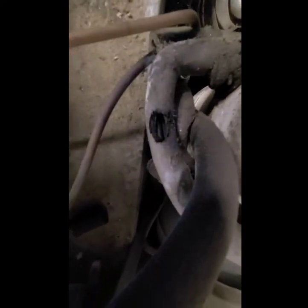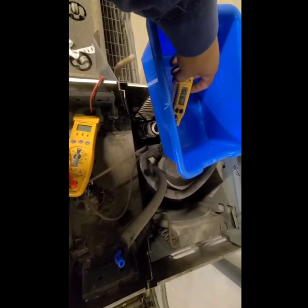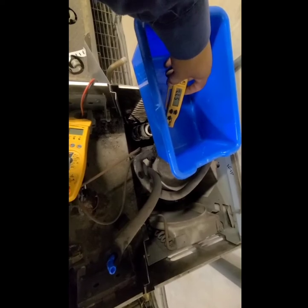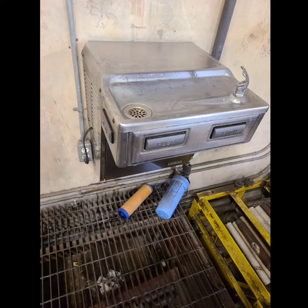Calling this one done — suction line is sweating, machine is good to go. I'm replacing the water filter; it only had one carbon filter to replace. After that, check for leaks and purge the lines so people can drink safely. Make sure the water isn't overshooting or undershooting and adjust the water regulator if needed. The water is coming out at 53 to 57 degrees. These people were very happy and the machine is good to go. Thanks for watching.